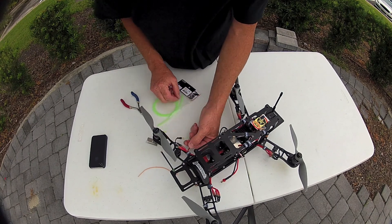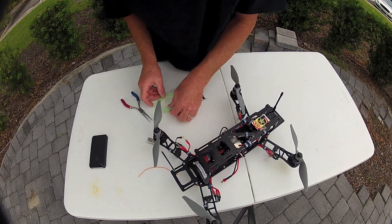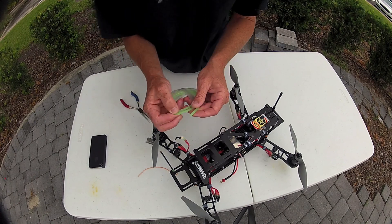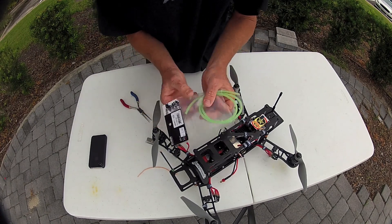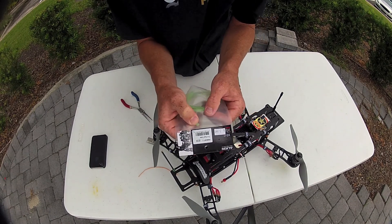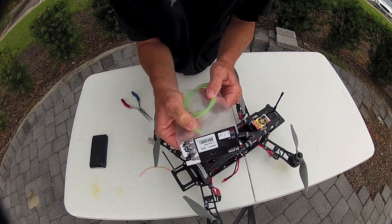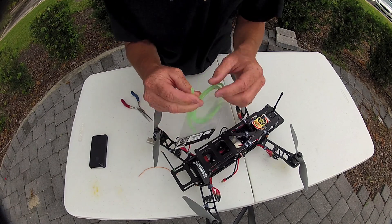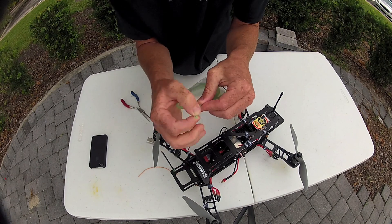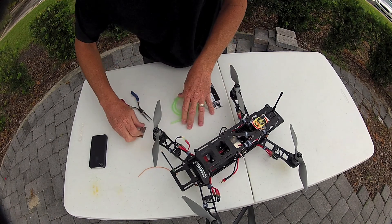Basically, that's all it is — a great, cheap, simple, easy fix that anyone can do. Just pick up some of this fuel tubing. You want thin walls. If you go to your local hobby shop, you can get standard fuel tubing. The best way to tell if it's thin wall, even if it's in the pack, is just take your fingers and press on it. If it's pretty stiff, that's not thin wall — that's not what you want. What you want is tubing that crushes much more easily because of the thin wall. It's got a larger inner diameter and is a little more malleable.